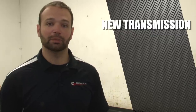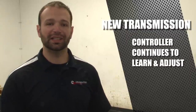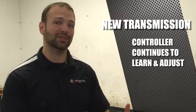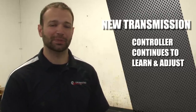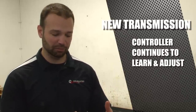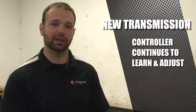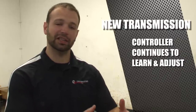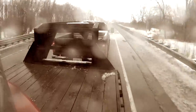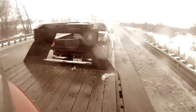So we covered the first week of your new transmission. But what happens over the next quarter million miles, depending on how you drive? It's important to note that the Allison is always adapting. Over the life of your transmission, you're going to wear the clutches a little bit and probably add some power. The controller is going to see that extra load and that extra fluid volume needed to apply those clutch packs, and it's going to make adjustments to the trims to try and keep the trans shifting as good as it possibly can. What we normally hear from guys is: 'I just towed a big trailer and now my trans shifts hard' — that's the Allison learning.